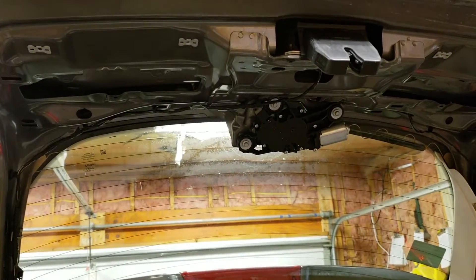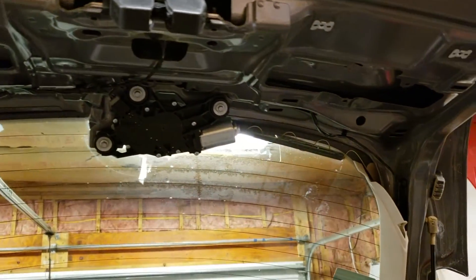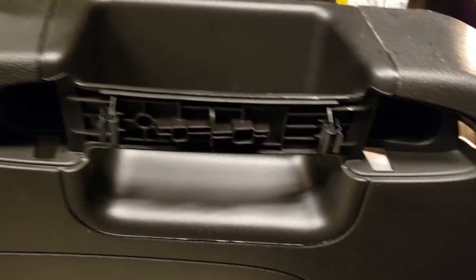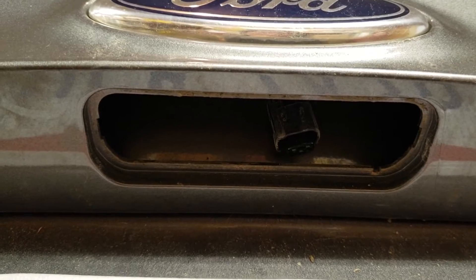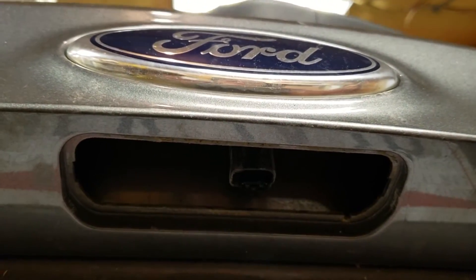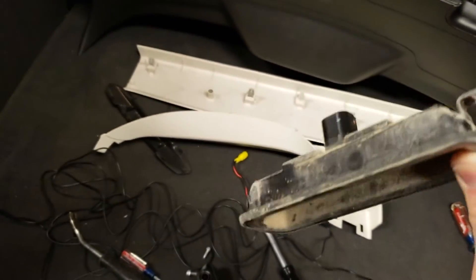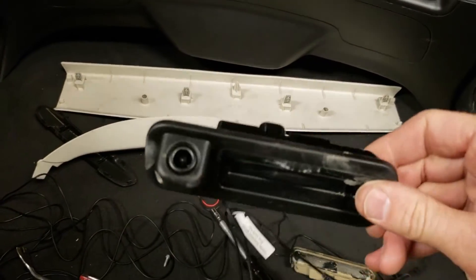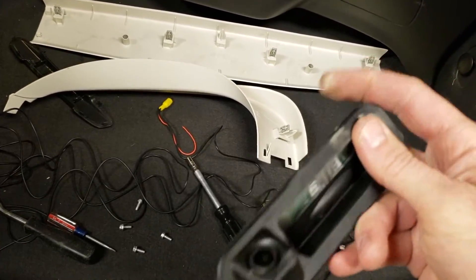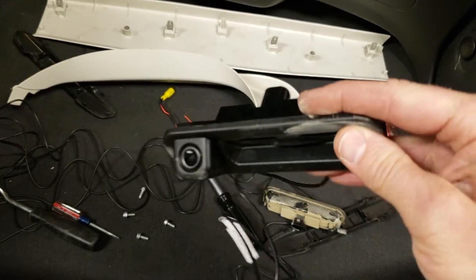Back in the back of the car for the backup camera — I took all the trim pieces off, most of them just clipped on. There are four 7mm bolts on these handles on the tailgate lid; after you take those out the rest just pops right off. Then pop the button out by prying with a small screwdriver, and release the connection — that's for the button and the light that normally shines on your license plate. Here's the factory button/light combination, and here's the one I bought on Amazon — I'll put a link below. It does plug right into that, and then it's got your output for your camera. It'll look factory when it's done.